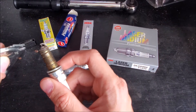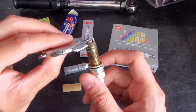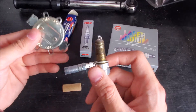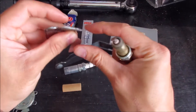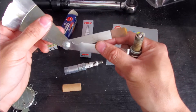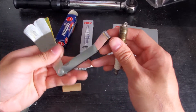So what we do now is we can check the gap of the plug. This particular plug has a very low tolerance, and this particular tool cannot get through — I can't check it accurately with this. There are other tools you can get which are basically feeler gauges. This one isn't specifically meant for spark plugs, but it is a feeler gauge, and I can verify the thickness with it as well. Depending on the manufacturer of the plug and your vehicle, the tool might change as well.